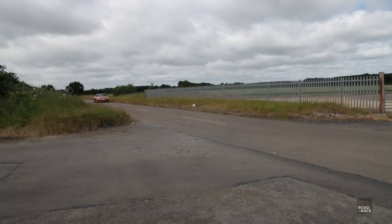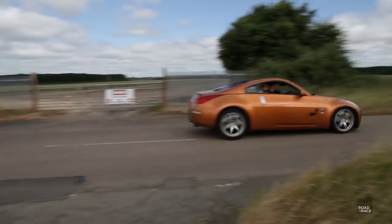Neil's been out on the track with the stock brakes and we've identified the problems, so now it's time to do a further test. This is the standard AMS braking test — we'll do 10 stops and measure where the car stops on run one, five and ten. This will basically assess the performance of the brakes as they get hotter. We sent Neil out to do this one as he's the test mule when it comes to driving.